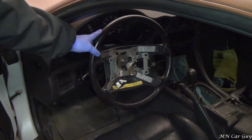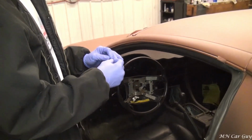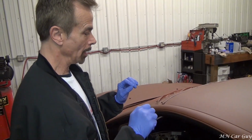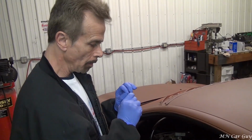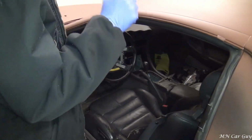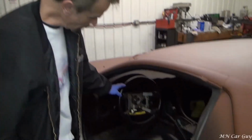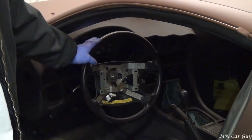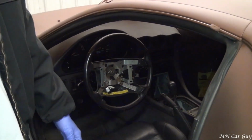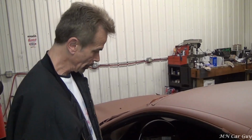The ignition switch with the key only worked intermittently, so when you put the key in, it won't turn. We were able to get the cylinder out of the housing and all that, lubed it, and it ends up that the alignment of these little pins inside the cylinder cannot line up correctly. It will work by tapping on it with a hammer, then it'll finally align perfectly and it'll turn. So we're going to replace the steering column itself. And that will include a new ignition? Yes. But the car will have 2 keys, one for ignition, one for the lock. Yeah, and we've seen that on vehicles before. It's not all that uncommon.